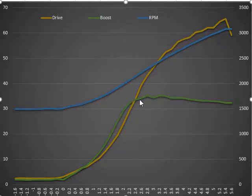We have those four things we were looking at. Did it achieve our boost? Yes. Did it overshoot? No. How linear is the boost with RPM? You can see it got up to 35.2, and at 3,000 RPM it went down to 32.3 - that's about a 3 PSI drop. While it's not optimal, that's still pretty good. There are some boost controlling devices where boost actually goes up as RPM increases, and you don't want that because as RPMs go up, flow goes up. When you push a turbo out of its map there are two ways to do that: a lot of pressure and a lot of flow. So if pressure increases as flow also increases, that's bad. This setup would actually work really well for turbo life because you're dropping boost a little at higher RPM, which helps keep that turbo alive.